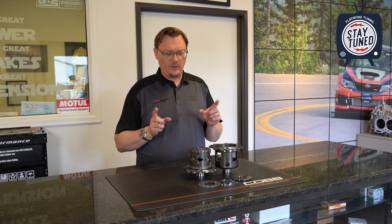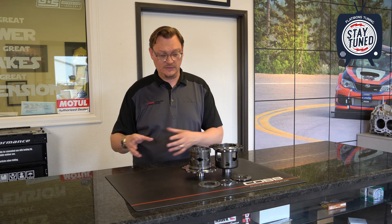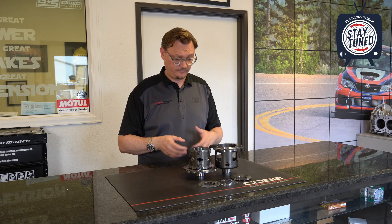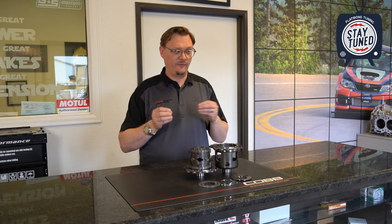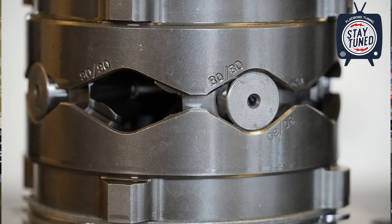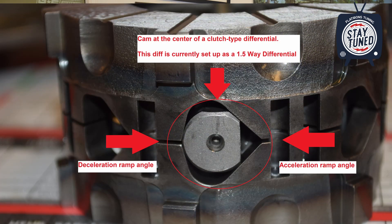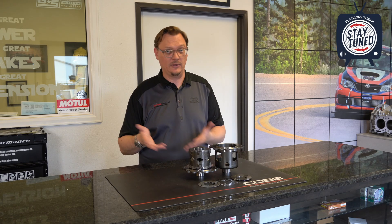The ramp angles that Mona uses are a little bit different from a lot of the Japanese main differentials. They have different options for the center sections, and they've done a lot of development so you're starting off at a pretty high level and can refine from there. In the case of this R180 differential, it is a two-way differential, but the ramp angles in the Mona diff are pretty significantly different compared to the Cusco diff, which means the way lockup builds with wheel speed differential is going to be different with the Mona compared to the Cusco.